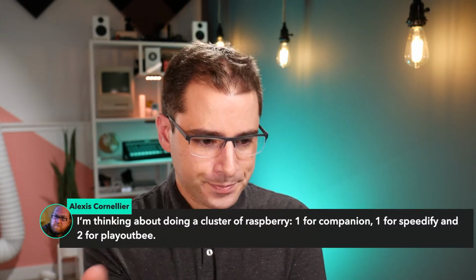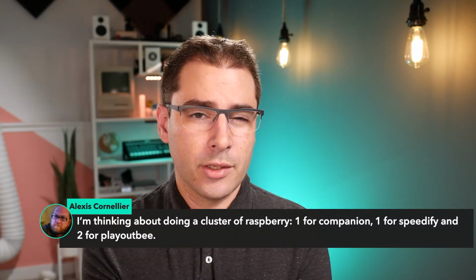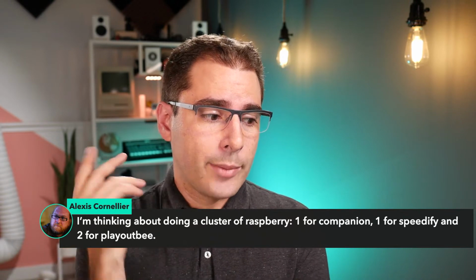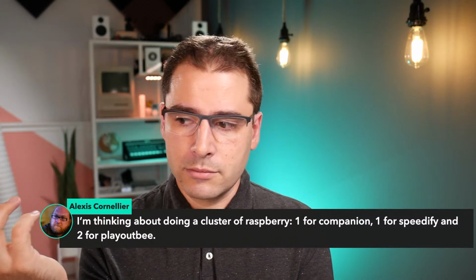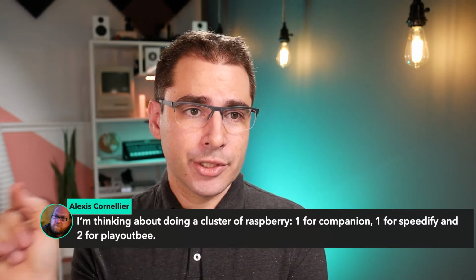I have mine doing the Companion, and it's the streaming bridge equivalent clone. I don't know what to call it. The RTMP server that can output the RTMP feed over HDMI. So I've used that when I'm pushing a video feed into my studio remotely, like from a YOLO box or from the Mevo. That was the camera. I just blanked on the name. And when I've done those streams, it's the same Raspberry Pi doing Companion as it is being that server, and it's been fine.